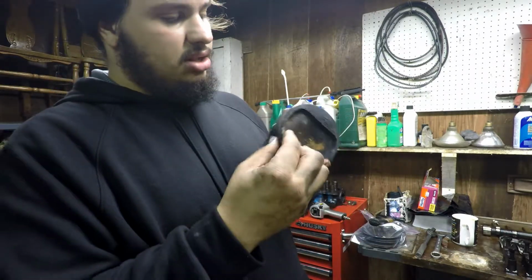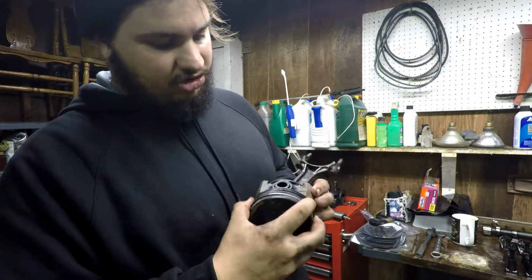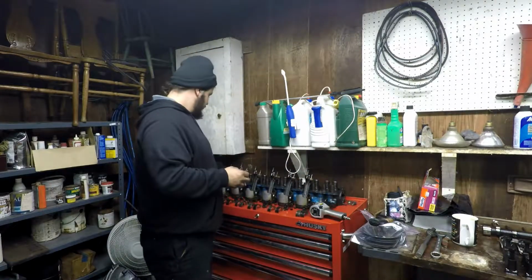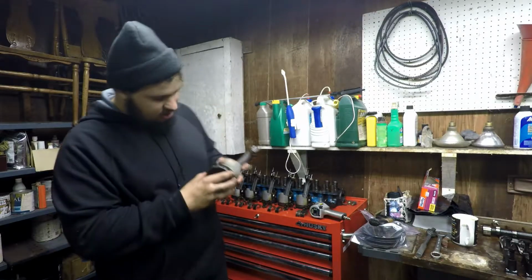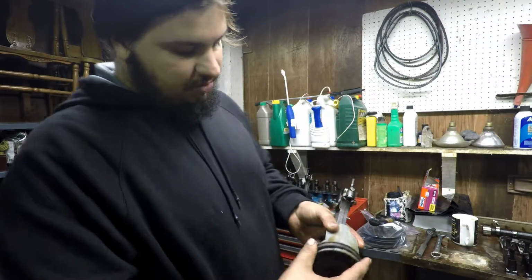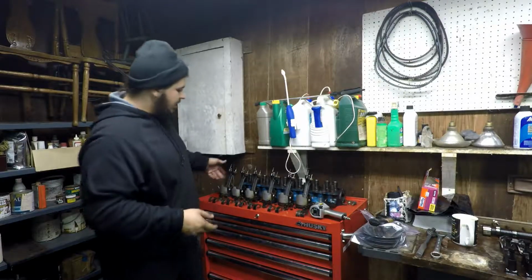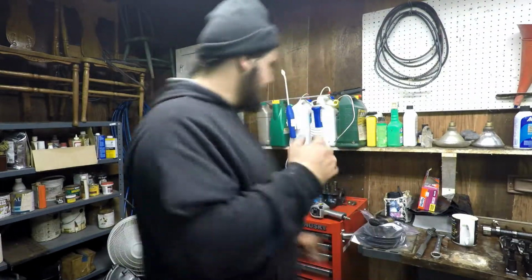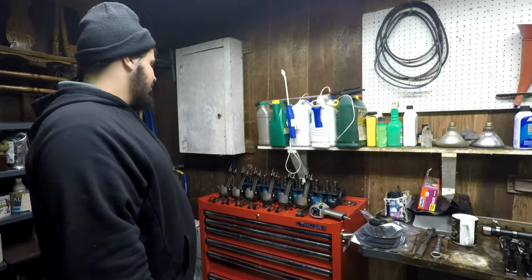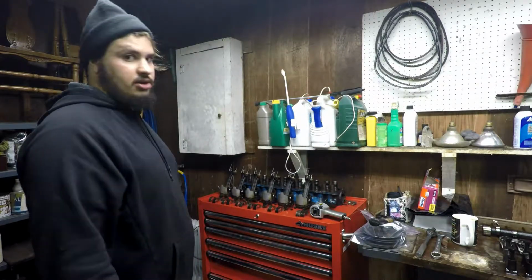And this one here in the middle, it's kind of jammed in there. It feels like it's all squished in. Even the oil ring is kind of squished in there, really. Maybe it's this one. Yep, that one's pretty busted too. Yeah, that one's split in half. So, yeah, every single piston had broken oil rings on it. Or, are they oil rings or compression rings? Probably compression rings. One or the other. They're all broken, so it was a good thing this came apart.